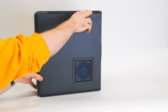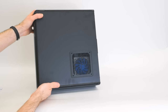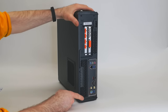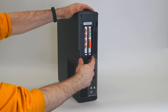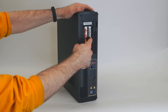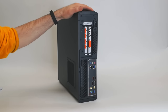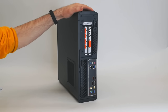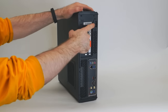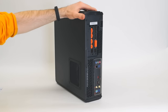So if you're ever going to be moving your case, or have kids or animals, you may want to put the screws through the fan filter into the fan to keep things in place. There's a little bit of mesh along the top and bottom, motherboard I/O, a little mesh above and below the graphics card. Your graphics card is roughly in the middle. You only have two expansion slots, so a three-slot card would be a problem. You also have a power extension — you plug in there and that goes to the power supply up front.